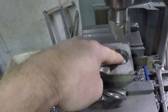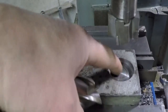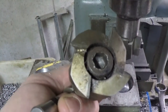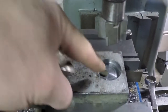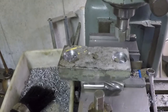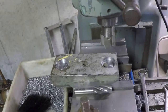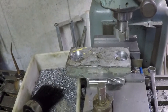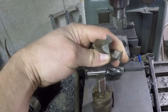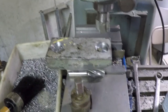So I put a two-flute end mill in — I've got this nice big two-flute end mill over here — stuck that in, and plunged out an area large enough to take into account that non-cutting center area of the shell mill. Then I put the shell mill in, plunge-cut, and got this nice flat-bottom hole — exactly what I wanted. That's the tip. It would be painfully obvious to almost anybody that knows anything about machining, but it wasn't to me until I stumbled upon it in a book about hobby milling. The guy was having a discussion about cutters, talked about two-flute mills and what they were good for, and that stuck in my head. So when I went to do this job, I knew exactly how to do it. Anyways, take care, bye bye.